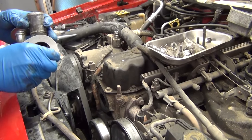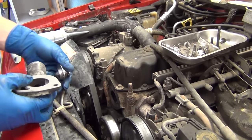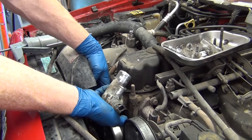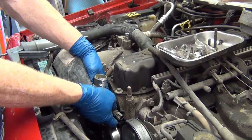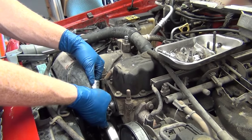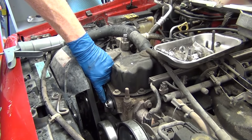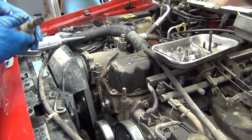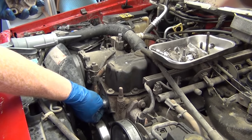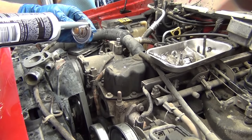There's no cutout for the thermostat here, so anyway. What I've always done is glue the gasket on with Permatex Right Stuff, then glue the thermostat in with Permatex Right Stuff. You can do it without and be fine, but what happens — and by people I mean I've done it myself — is you go to put it on and in that last little second before you get the thermostat housing on, it drops just a little bit. Now it's too thick on one side, it's going to leak, you've got a bypass, and it takes forever to heat up. Using a ton of silicone will patch the leak but then it's not doing its job properly.